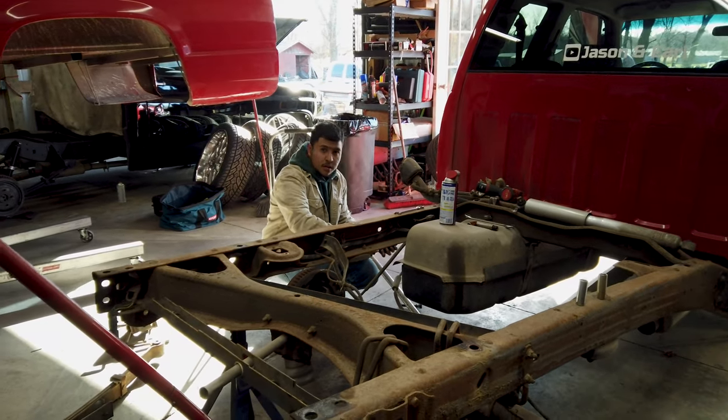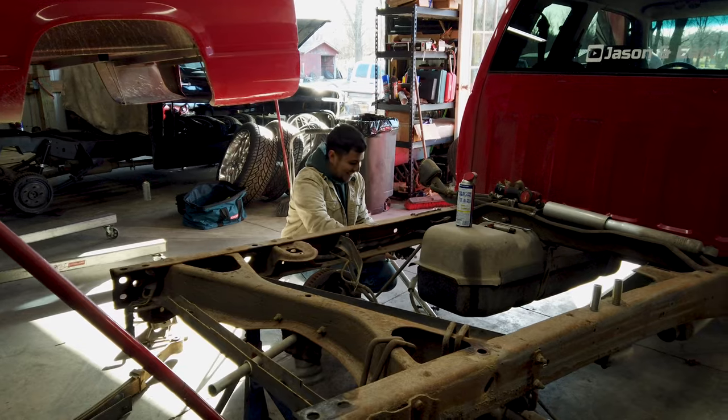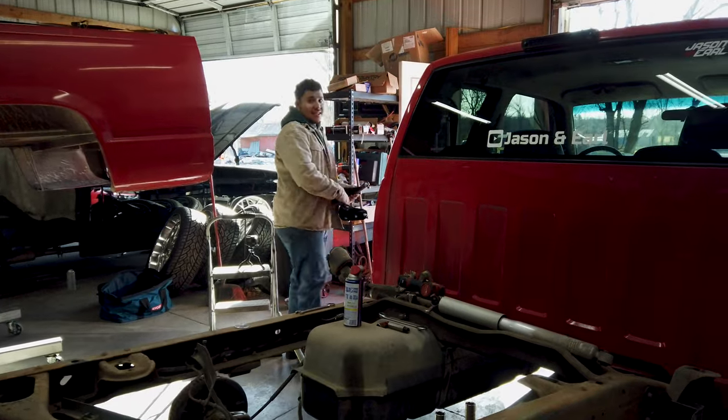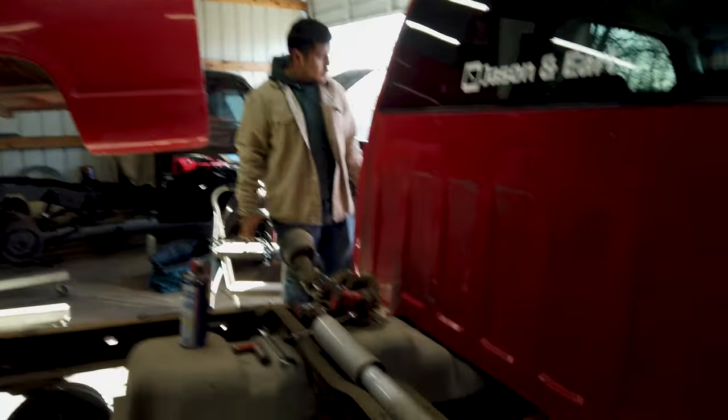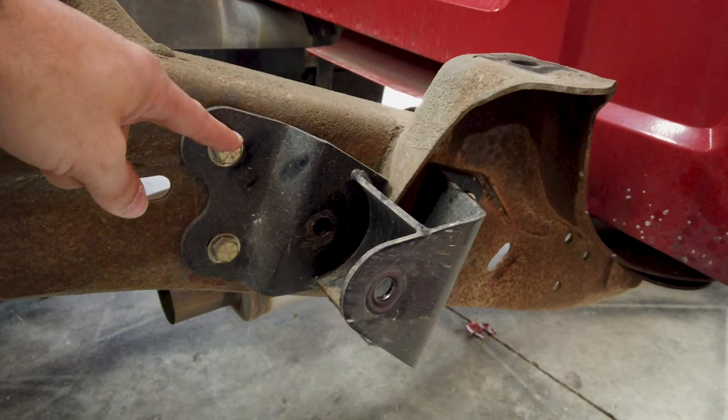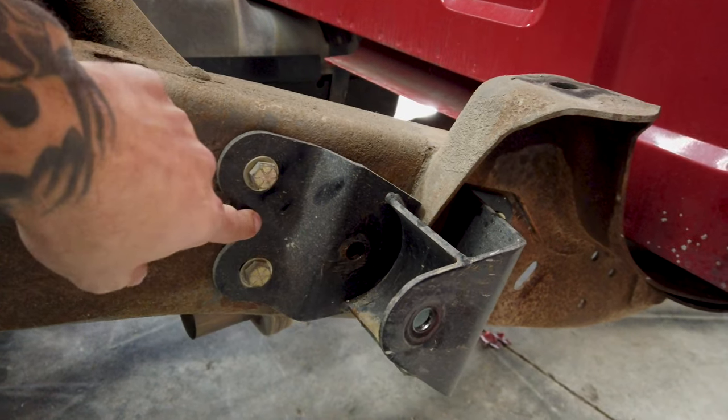So I guess we're going eight, is what this means, right? Well, it was destined. All right, so here's the deal, folks. I guess they're checking on parts, but what we had to do, as I was mentioning, was replace these guys with the stock versions, because these are the Belltech versions for the original drop kits. So in order for the kit to go 6 inches down instead of 8 inches down, we have to have those stock hangers on there. So they're working on seeing if they can find any. Worst case scenario, looks like we're gonna do 8 inches instead of 6. So we'll see how it goes.